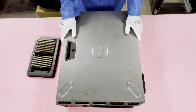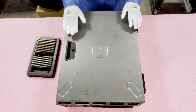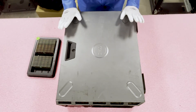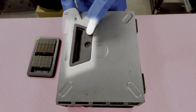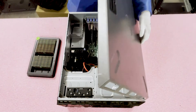Now that we have our ESD gear on, we're good to open the machine. You'll notice we've flipped it to its side with the leg folded in — it's just easier to work on it this way, though standing it upright is completely fine too. Make sure the latch is set to unlock; if it's locked, just use a simple Phillips head to turn it, then open it up and pull the door right off.